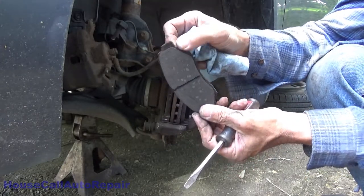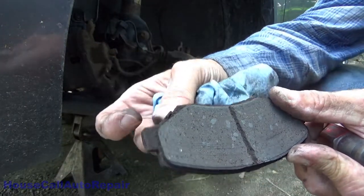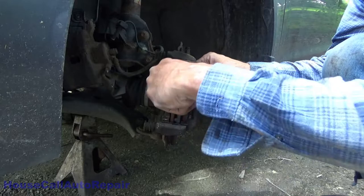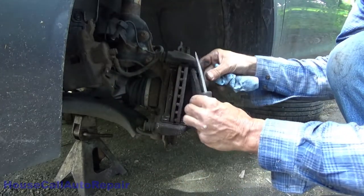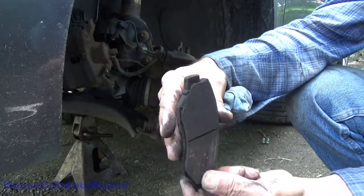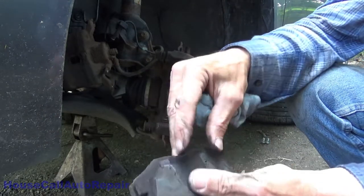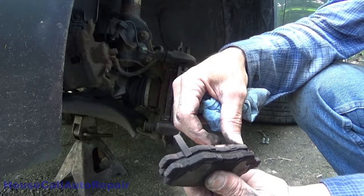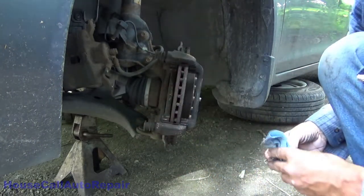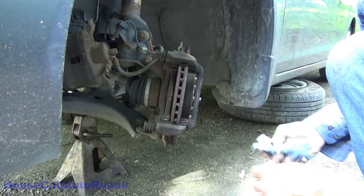Not bad at all. And we just started getting to the, actually, I don't think we've made it to the squealer yet, but we're close on this one. Again, that's the inboard pad leading edge for the squealer. Again, pretty evenly worn, and I must say I am impressed with the fact that both the inboard and the outboards wore equally. That means that I can pat myself on the back for this brake job. Pad slap from last time. This time, these rotors are worn to the point where the rippling is justifying a replacement, so we're going to be putting new ones on.